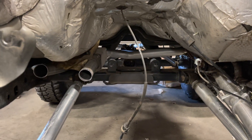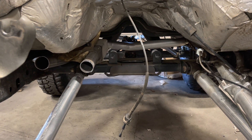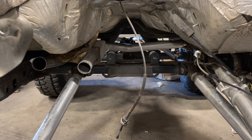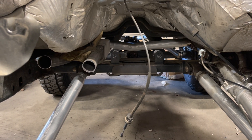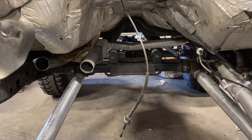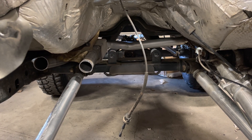Now this one here is going to be a tricky one. This has got a Genrite three-link in the front and that mount is going to be tricky to put an eight-speed in, but we're going to do it somehow, some way. We'll talk about how we make a 5.7 liter truck Hemi and an HP75 with the 241 non-Rubicon case work in this Jeep.